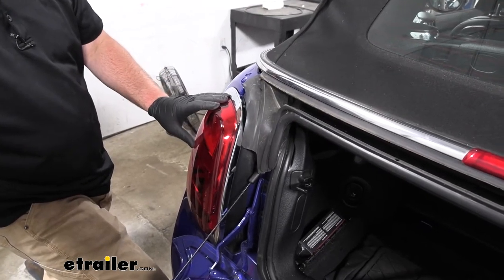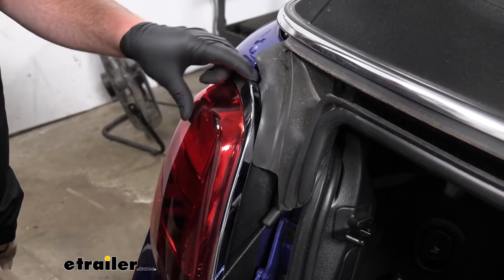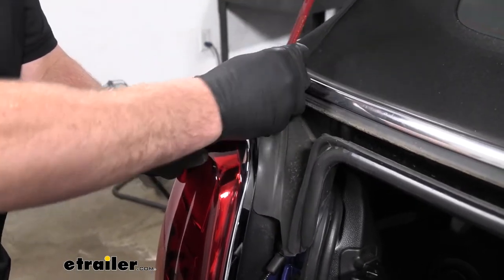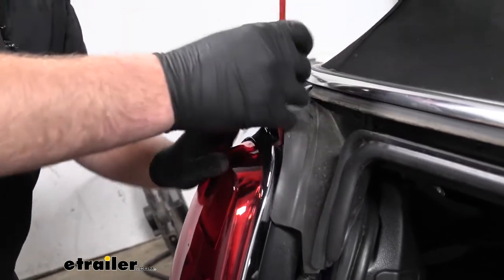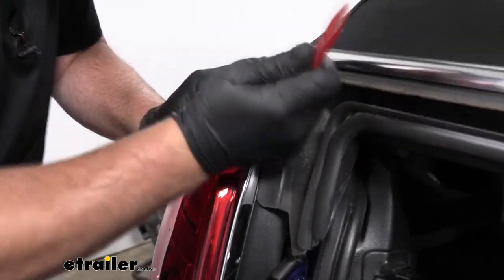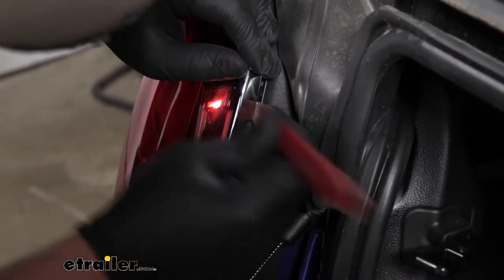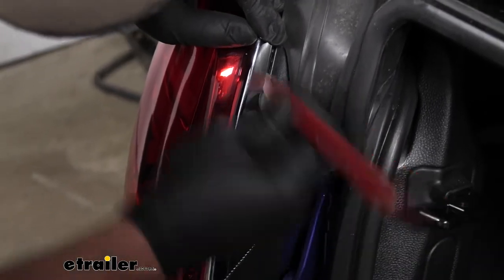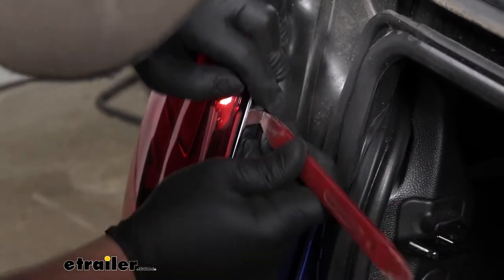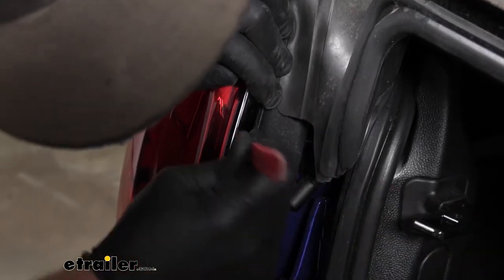What we need to do is remove our taillight, and it's going to involve a couple of steps. The first one is this chrome trim ring — we're going to have to remove that. Take a plastic trim tool and carefully work behind that trim ring. There are some clips in there we're not going to be able to see until we actually get it off, so be very careful — this is kind of brittle plastic. Take your time, work your way down and around the whole trim ring, and once you get the first bit to free up, all the other clips just kind of want to come off.